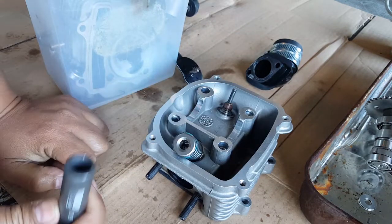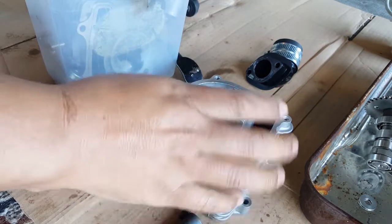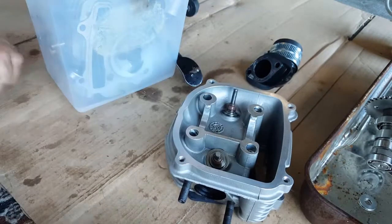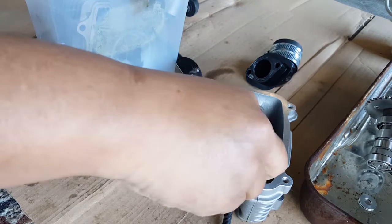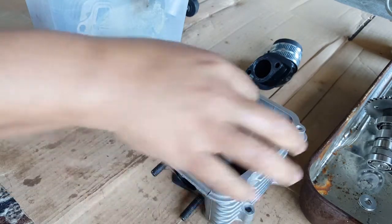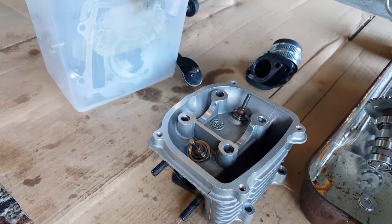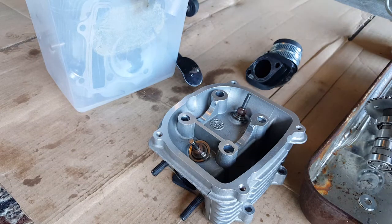There we go, look at that. Boom, broke the teeth off. Not like broken, but came in 2 pieces like it should. There we go. Give it a good whack if you have a hard time doing that. The Viton seals, they're oil resistant, but they're still rubber. Let's go and get them off. Okay, let's go and bring our 2 bolt trick and get that stud off right away.